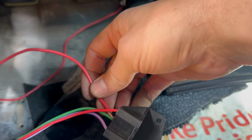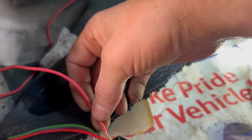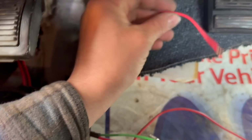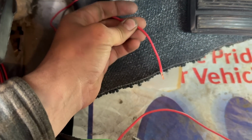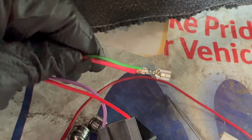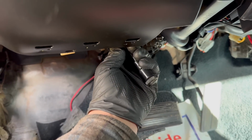And here's that trigger wire. I'm going to connect it here to the input of the headlight dimmer switch. That way, as long as the headlight switch is on, that relay will be energized. Whether it's set to high beam or low beam, the doors will stay open. It might be a little cleaner to run that up to the back side of the headlight switch, but frankly, I'm way too lazy to do that. There you go. Kind of crimped and kind of soldered. And now we should be rewarded with squealing, slapping headlight door noises.